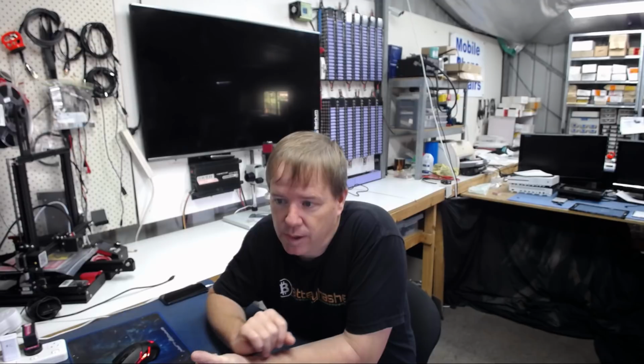Baronia Heights. Why don't people use commercial house batteries in motorhomes, RVs? Probably because of the vibration, I would say. I think a lead acid would probably handle the vibration a lot better than some of the lithium cells, and the way you've got to connect them, and the little fuses and stuff might vibrate loose. Well, that's the DIY stuff. Maybe you could use a commercial solution. Maybe it's weight, maybe they don't need that much capacity. Maybe a little 5 kilowatt one would be good in a van. At least you got the depth of discharge, way better than the lead acid batteries.